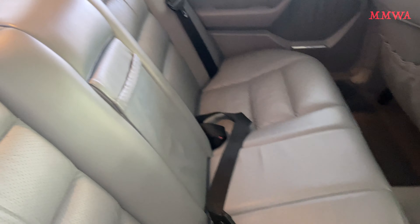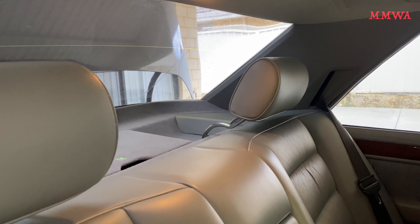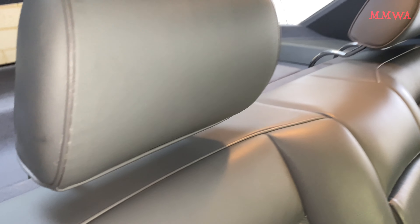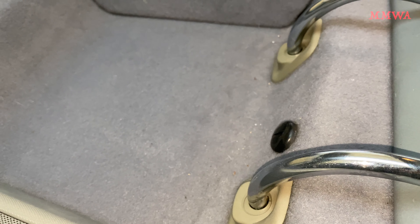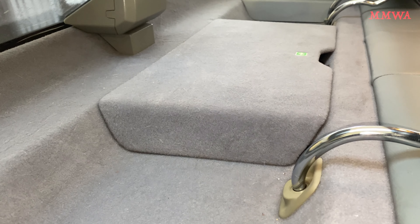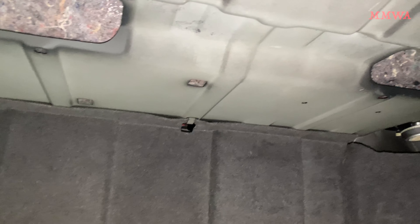So this is my blue-black 124 and as promised I'm going to show you how to remove those plastic covers from the backside. To remove these headrests I wouldn't dare try and pry them out from the top — they've already started to look like they're changing color due to sun damage, and that's just a recipe for exploded plastic.